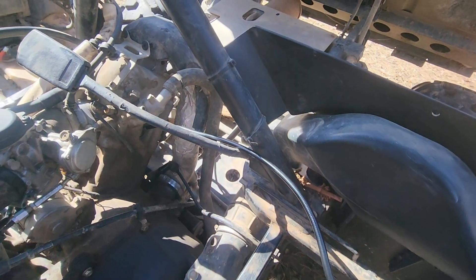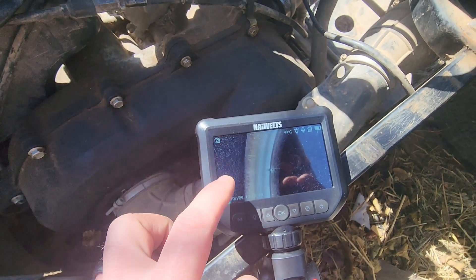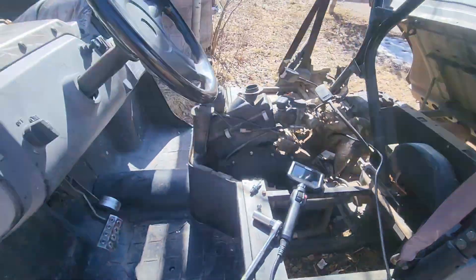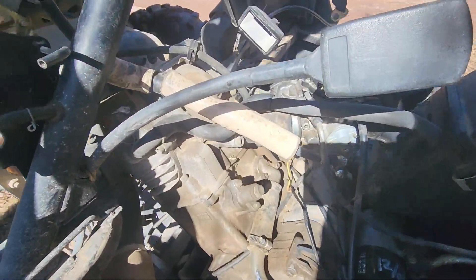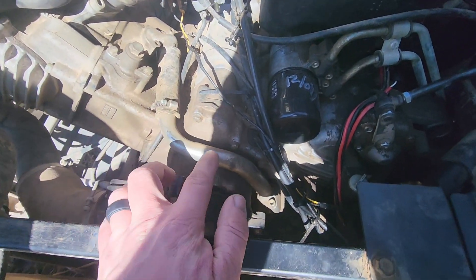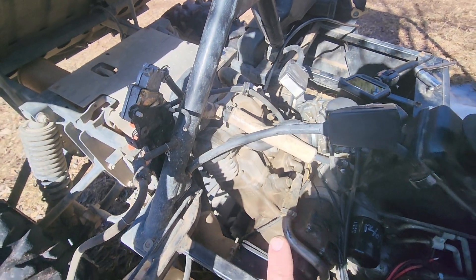This thing is awesome to have for situations like this. I thought it was a piston ring issue and it might still be, but the fact that the cylinder wall is pretty clean up to where the rings top out, and then we've got serious oil caked all on the cylinder wall above that up in the combustion chamber - this might have some valve seal issues or something else going on. Are these overhead valve? It could be valve seals, or again just something else causing that.